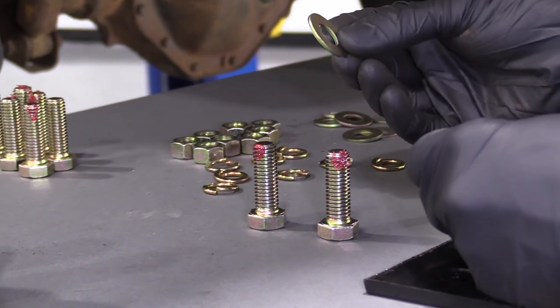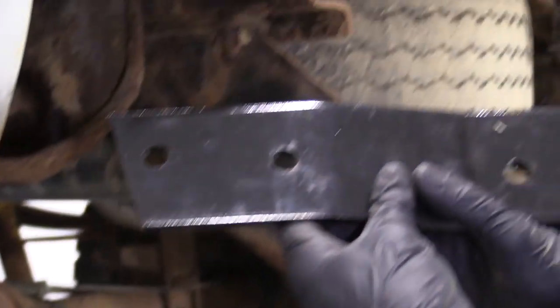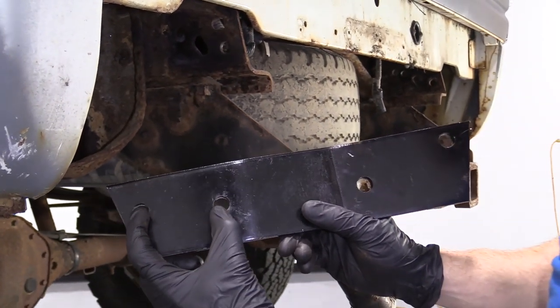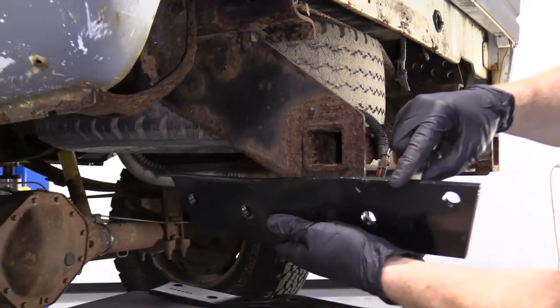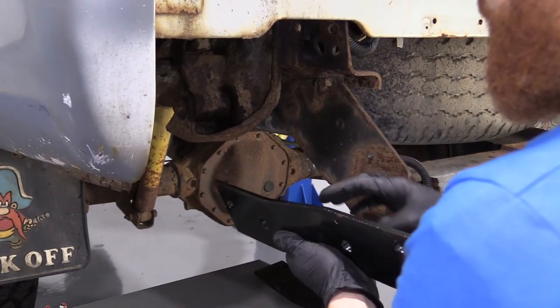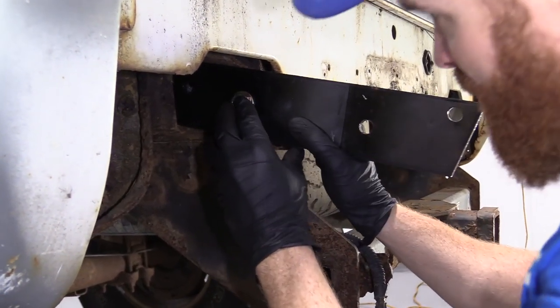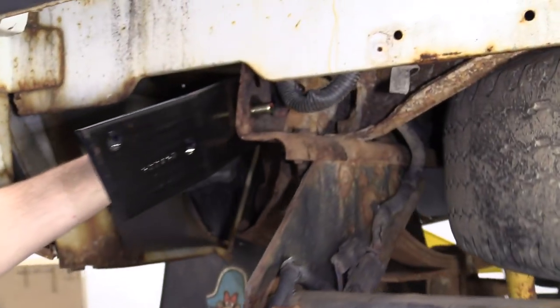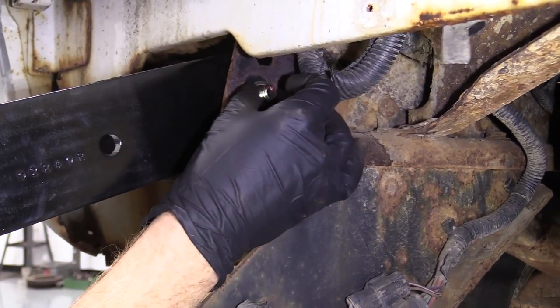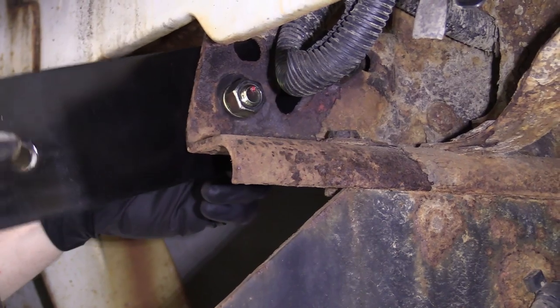So we've got a couple of our mounting bolts here. We're going to take one of these flat washers. We're going to take the bracket that matches up — what you're going to notice is that there are holes that are close and two holes that are much further away. The holes that are closer together fit on the frame. We want to pay attention to the way the bend is, because we remember the frame is wider than the bumper mounting area, so when we mount this onto the frame it's going to be going in. Take one of your bolts, put it through this hole, line it up with the next hole. We're going to take one of our locking washers — they've got a little slit in them. It's your prerogative if you want to use a little thread locker on these. We have this on there just like this — you can snug them up, but we're not going to tighten them yet. We need this to be able to move around; once we get the bumper on we need to level it, set it wherever it needs to be so it's not hanging down looking wonky. We'll leave these nice and loose and do the other side the same way.